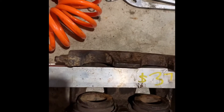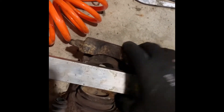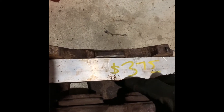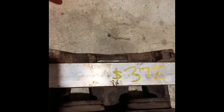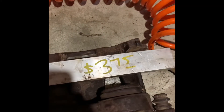This piece of aluminum from the local metal store works perfectly. It gives enough room for the pistons to travel so you can get them out. Hopefully both pop, but if only one pops it'll stop, then pressure will build so the other one pops too. Then just shove this in there, give it some air, and hear it pop.